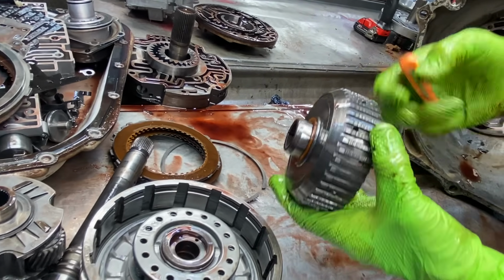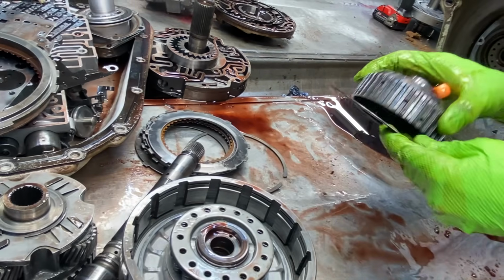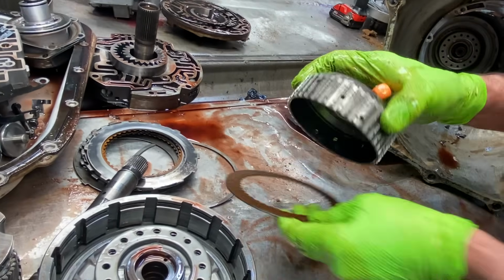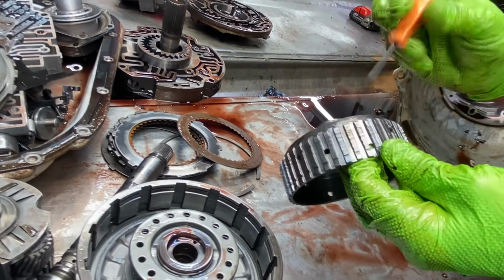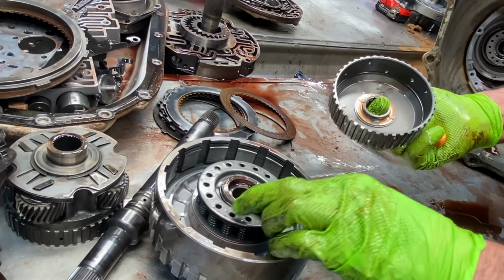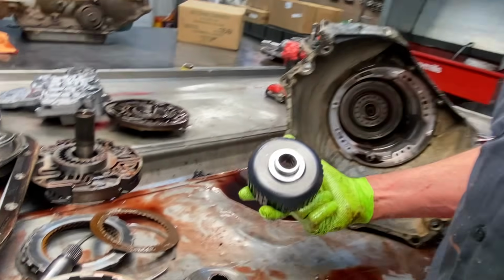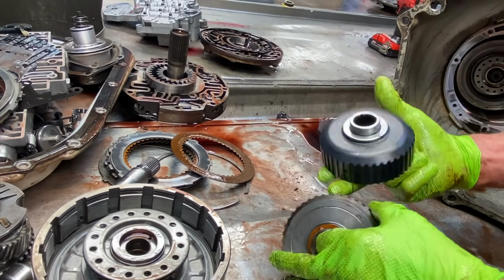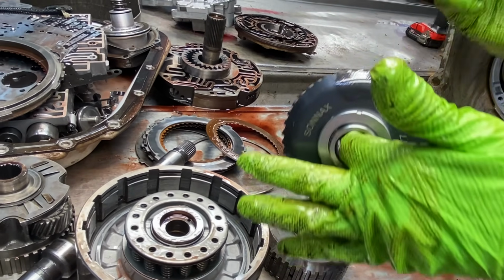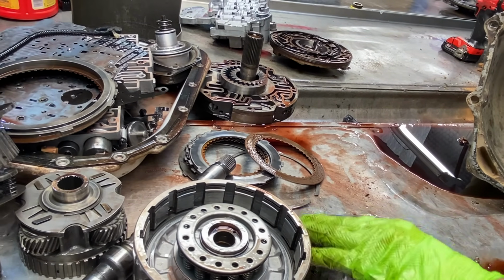In your clutch hub, you can see here it's just wore plumb out. Oh, goodness gracious. This thing's making metal like crazy. I bet before they serviced it, that pan was just full of metal. Look at that. I don't think I've ever seen one that bad. But like I said, we're going to put this beautiful hardened Sonnax one in here and get rid of this old cheapie. If you listen, pot metal, got the ring to it.